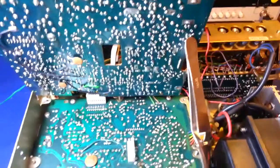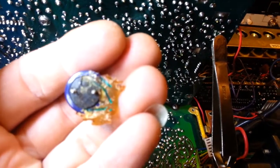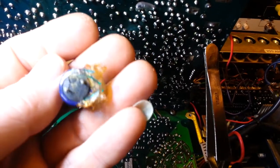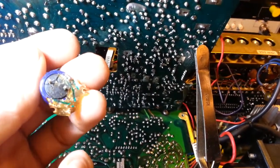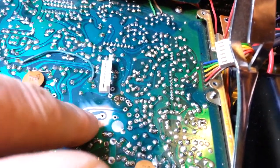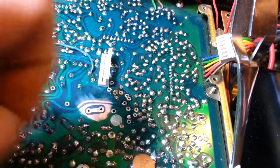Back with the GE Super Base, got the top board pulled up. We're dealing with this leaky capacitor — the thing really split open and belched out all over the circuit board. You can see the rubber on the body is all split open. It leaked through to the other side of the board and had a little bit of corrosion, but that was easy to clean up using a fiberglass eraser.